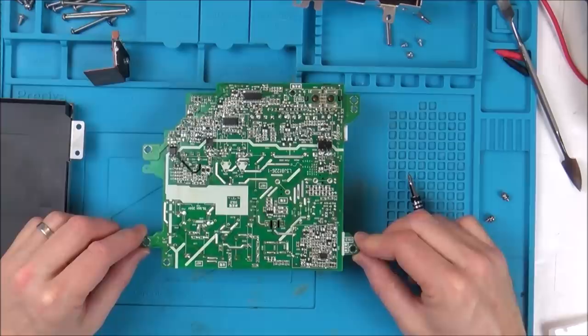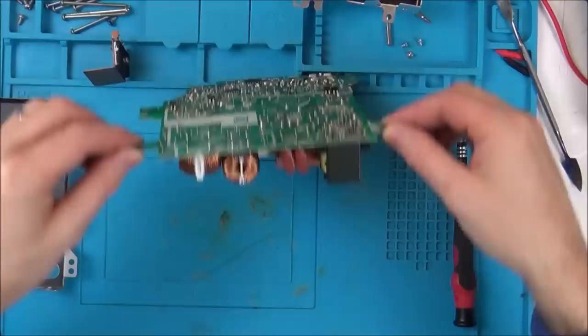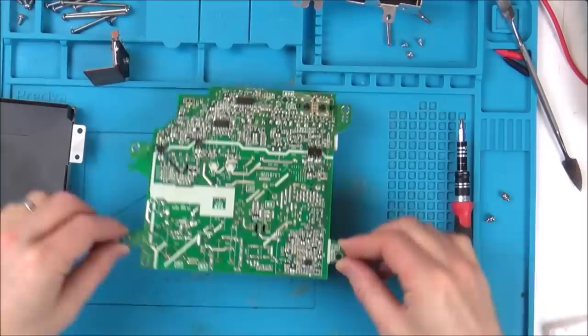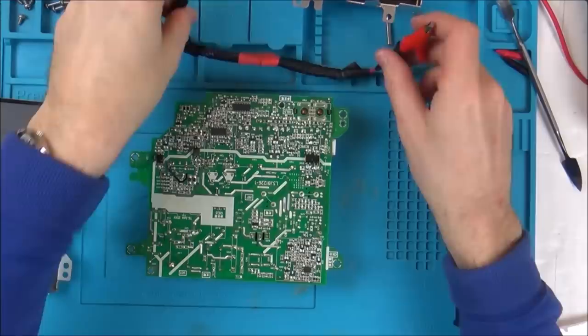Right, so you can see the demarcation on the board. It says here, hot, cold. Well, let's drain it and then we can worry about what's what. So we've got two massive capacitors here and I presume there. So let me get my little thingy here. This has a, I can't remember what size of resistor. In fact, I've put about three resistors in here to drain it, to convert the power into heat.